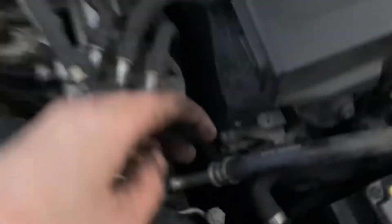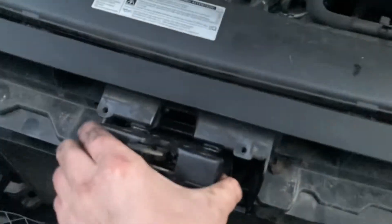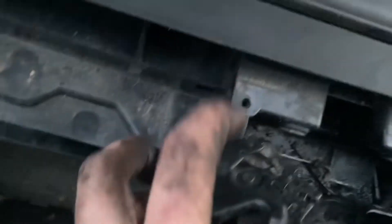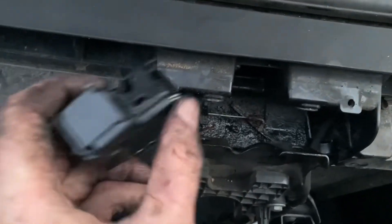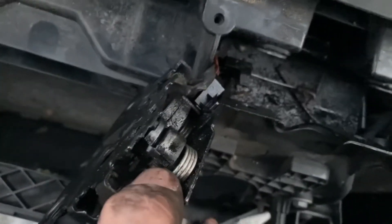This piece needs to slide out — also remove an electrical cable. Once you take all of this front panel off, it's in with two bolts that connect it, and once that's out you can wriggle it free. There's a plastic bit you can remove by pushing it in here, and that'll give you some freedom to push the mechanism and get it off the latch hook.